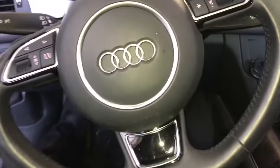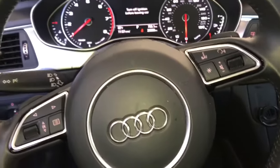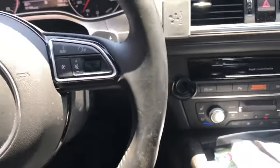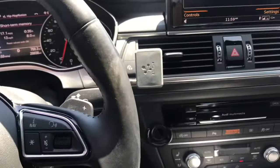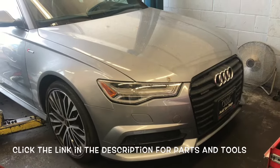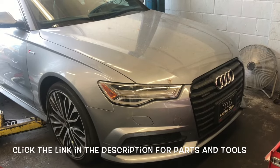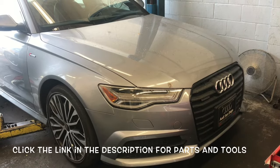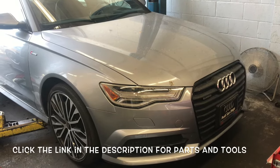Now start the vehicle up. If there are any maintenance lights on the dash, it'll require a scan tool to reset — all scan tools are different, so just follow the prompts on yours. The very last step is to double-check the brake fluid level in the master cylinder. I'll link up all the parts and tools I used in this video in the description so you can find them there.